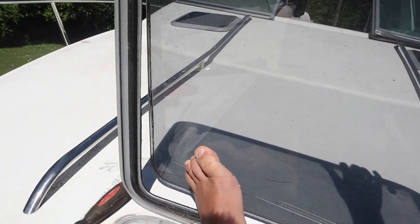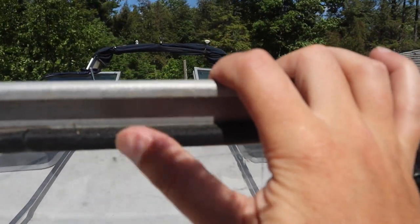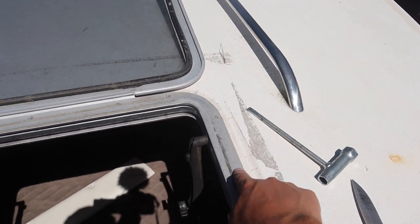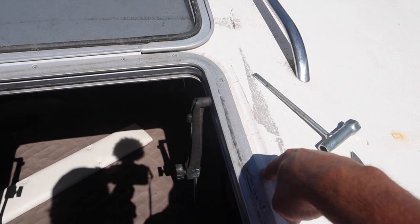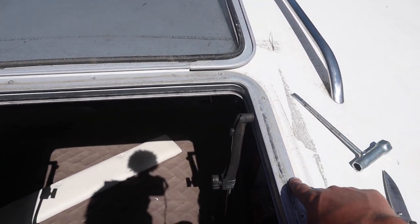So there's two problems here. First of all, you can see the plexiglass isn't even sealed in there correctly anymore, so I'm going to reseal that. This foam is getting old and crusty, so I'm going to replace it as well. And then I'm going to reseal the actual hatch here. It screws into the deck — it's basically two shells, a shell on the inside that you silicone to the shell on the outside, making it like a sandwich, and then you screw it into the deck.